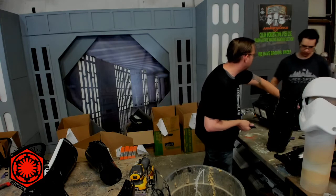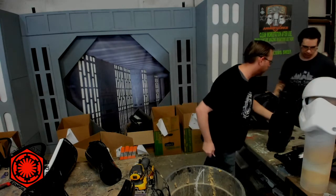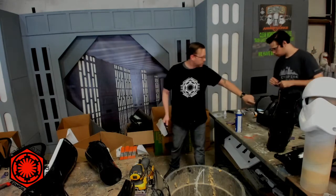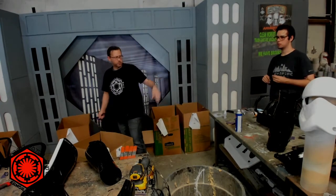When you're like, build it up, just take some bigger pieces. Here. There you go. That'll do it. Put a couple of those across there. Take the filler and build. That's good practice for you. You want to fill that seam too. The Evercoat lightweight. Just glue it all in place first. Okay.